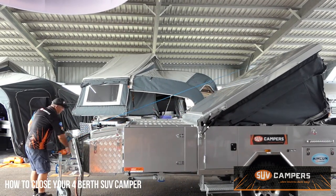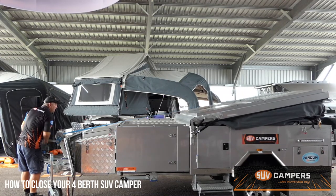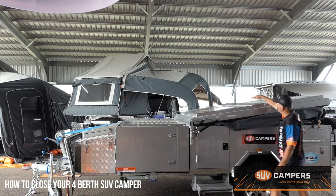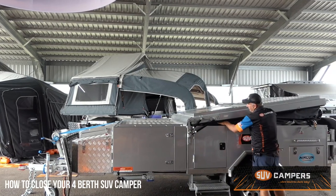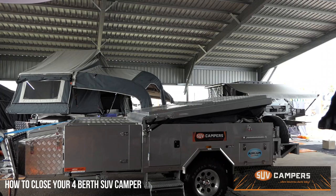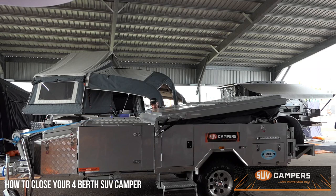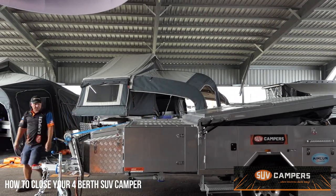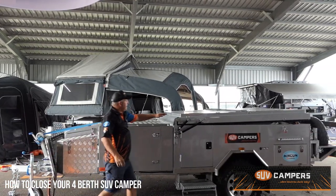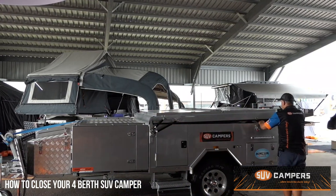When you're winding this down, it's very simple on the winch. The first place I stop to do a tuck-in is when the winch cable itself hits these middle ribs — that's where you do your first tuck-in. Push it all over towards the center, and the same around this side. Then just down on your winch cable again until the winch cable is hitting this front rib of the camper trailer, and that's where you do your final tuck-in of all your canvas.